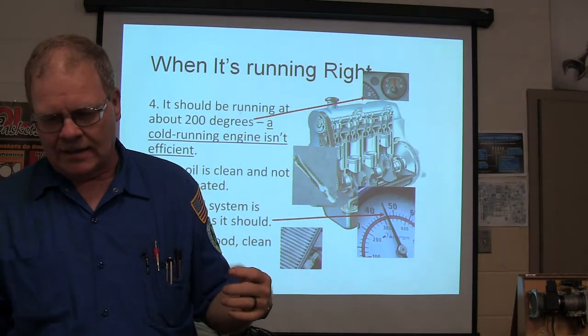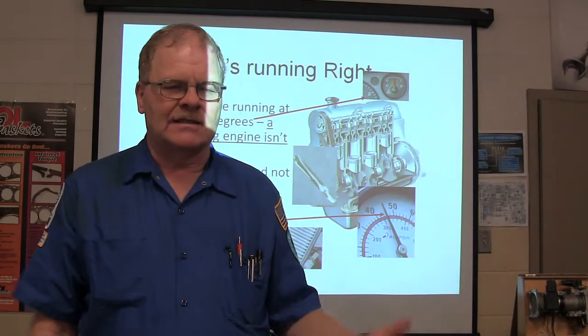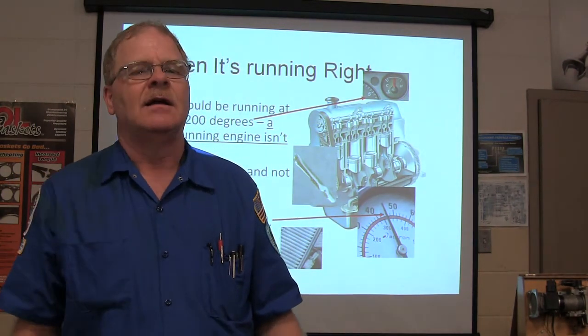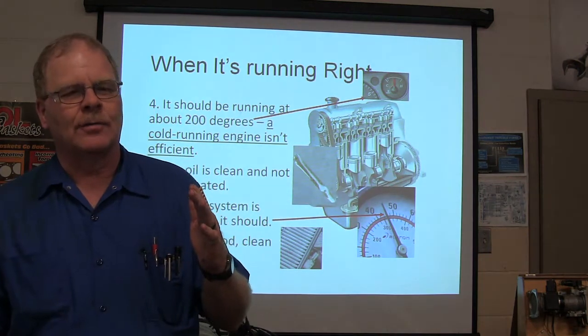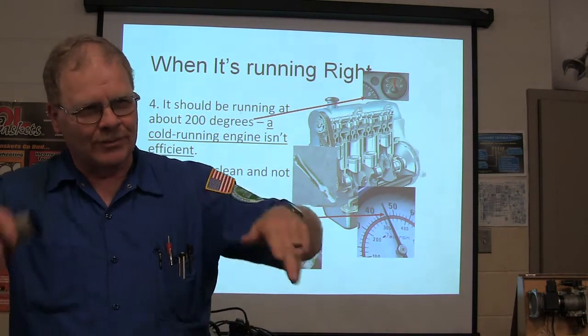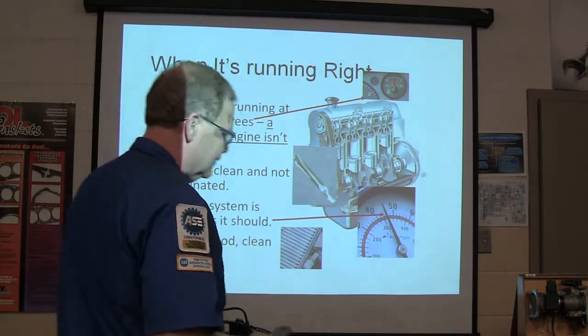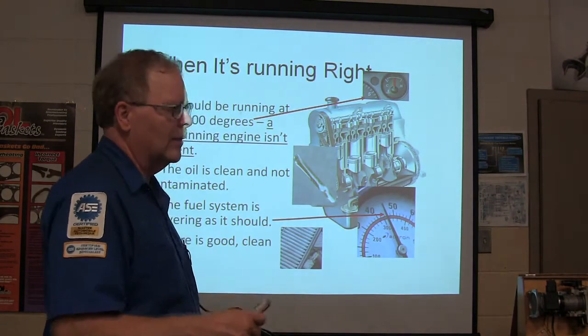I will tell you that you can have not enough fuel pressure on these old CSFI systems, like that white Chevrolet pickup's got on it. If it's got 55 pounds of fuel pressure, it needs 60 or it won't start. On the ones with the poppets, I like to convert those with the electronic kit. Looks the same, works the same, but a whole lot better.